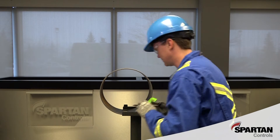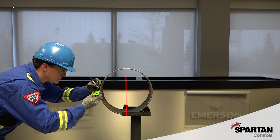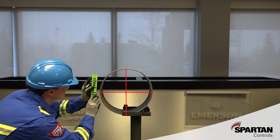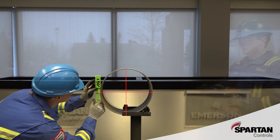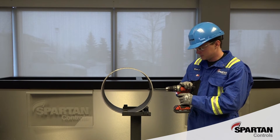On a horizontal pipe, one method of locating the holes is by using a band or tape around the pipe and a level to find the tangents. The holes should be horizontal regardless of exhaust pipe orientation. Drill the two holes using the 9/16 drill bit provided in the kit.